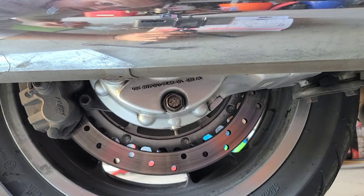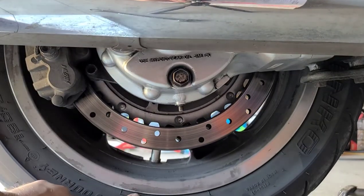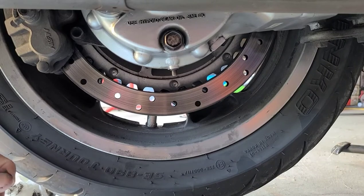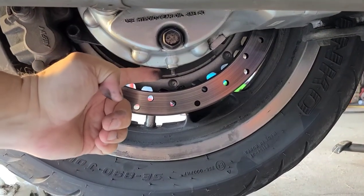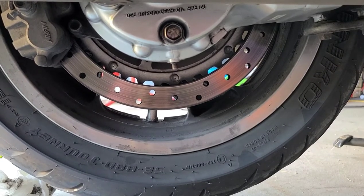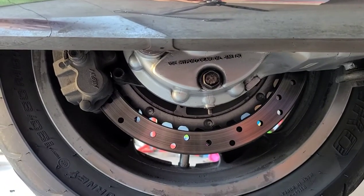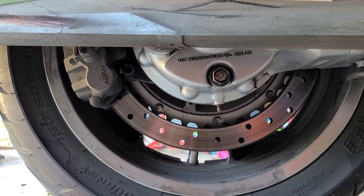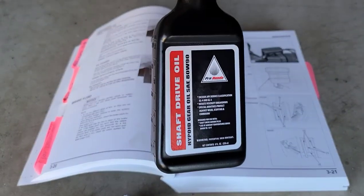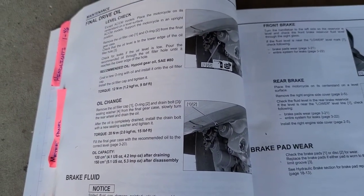We shall see — we'll keep an eye on everything. I occasionally see this ring spot here, and it doesn't necessarily feel oily, just dirt and grime. Right here is this little drain nipple — sometimes it has some almost clear fluid on it, which maybe it is pushing some here and there. There's a breather on the top of the final drive which I'll try to get to from behind to check if anything's coming out. There's the shaft drive oil — always good to have a manual, but here are the pictures if you don't.